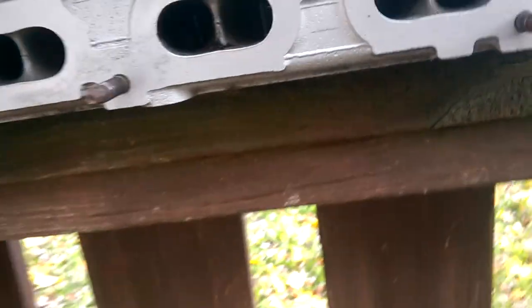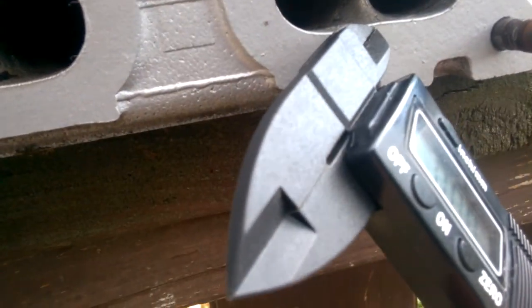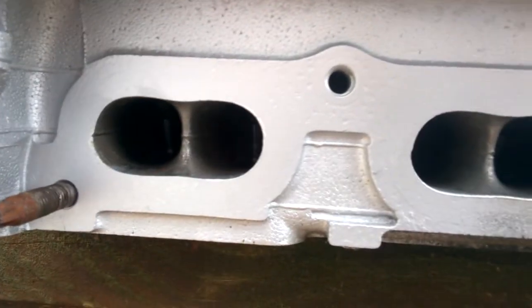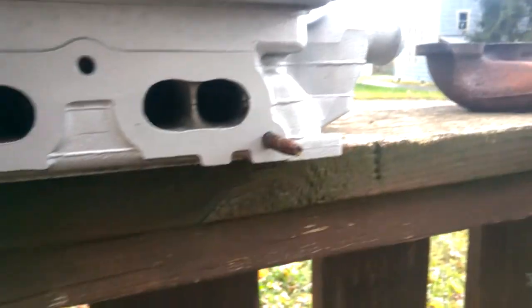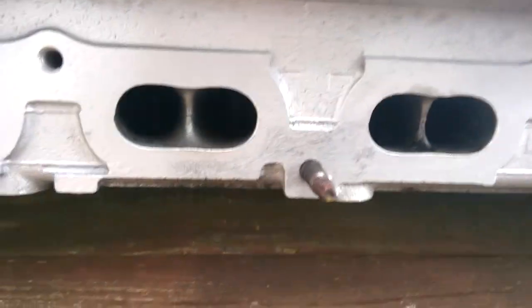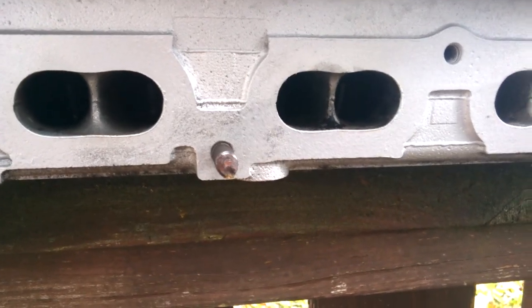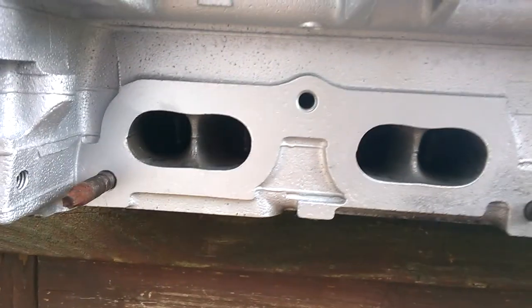But when porting, the most you'll need to really port will be maybe just to match out this little notch in the top and the bottom. There are castings on the inside you would want to polish down, because that will create hot spots in the port and disrupt your exhaust flow. Porting-wise, you're not going to see a lot of gains on this engine for street use. A full racing port is different because they will actually go down into the valve seat area and port the entire surface inside there and polish it out for better velocity. The reason I don't suggest that on a street engine is simply that you're going to put all your power at the top end, and you'll actually lose that low RPM response where the car is consistently being driven at 45 to 50 miles per hour.